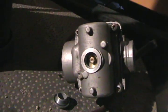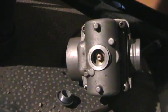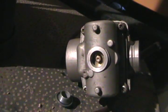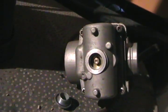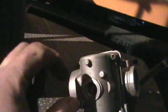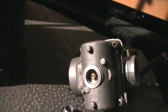Never use a drill or anything sharp to clean these jets. The very best thing that works is just get a regular pin that's smaller than that hole and grind the point off so it's just got a flat square edge on it. That flat square edge can catch the dirt and just keep shoving it out. Once you have that jet taken out in your hand, hold it up to the light and look through it.